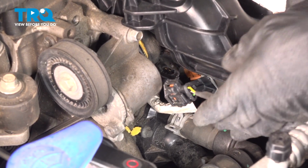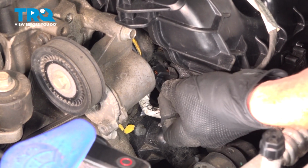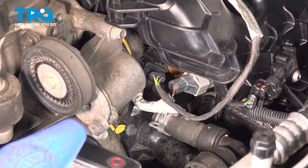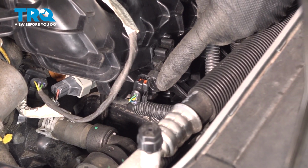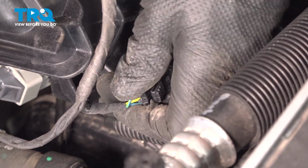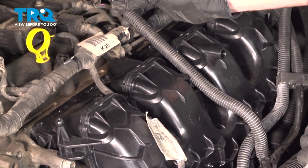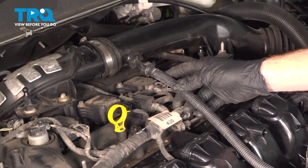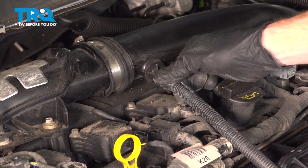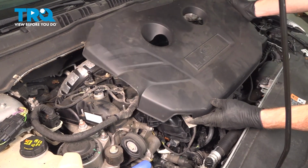Let's get this wiring harness down here. We have two more connectors. This one goes right underneath this ear of the intake. I heard a click, a light tug. Moving along, we have our map sensor. Now we can follow this up along the top here. We have another line that goes onto the air intake system. We're just going to take this and we'll press it right on. One last quick inspection in this area and we can continue on to our engine cover.